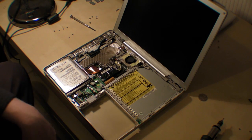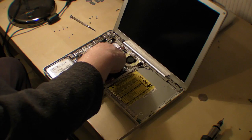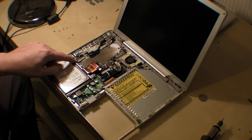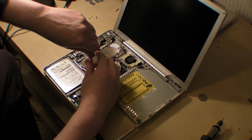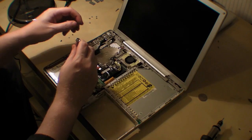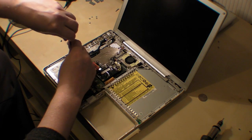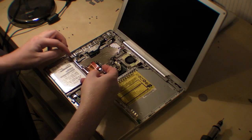It is so easy now because all you do is pull up the ribbon which is connected to the hard drive, and that lifts up like so — quite easy. Now we've got two black screws here and here, so all we have to do is unscrew those. Remember, this is an IDE hard drive, not a modern SATA hard drive, so if you want to upgrade it will have to be an IDE hard drive. The two black screws come off this mount.